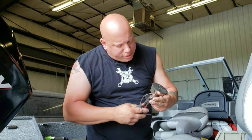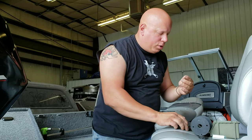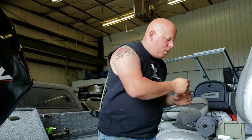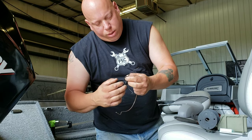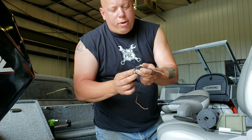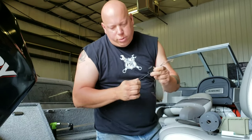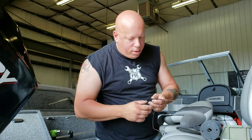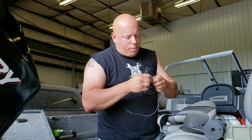So it might not be obvious to some, anytime you straight wire direct to the battery, you'd better be adding a fuse, or you're just trading one problem for the next, meaning a fire. So I bought this fuse holder, which will go in line. You just put an automotive style fuse right in here and cover it up, help keep the water out of it. It is a boat after all, although this is most often dry, even in rain. So again, we're straight wiring it right to the battery, which is why I'm worried about it.